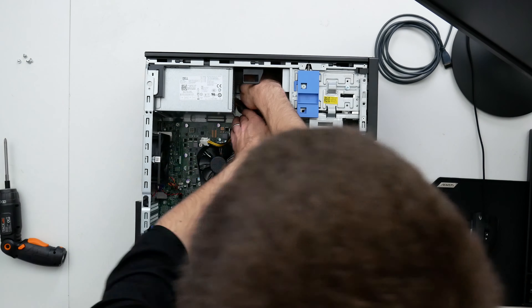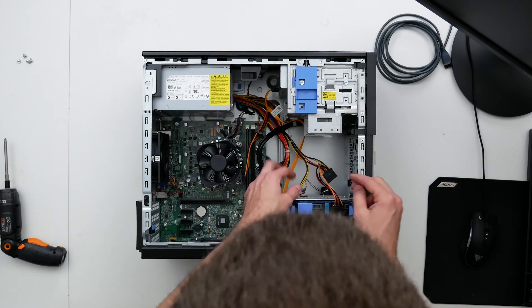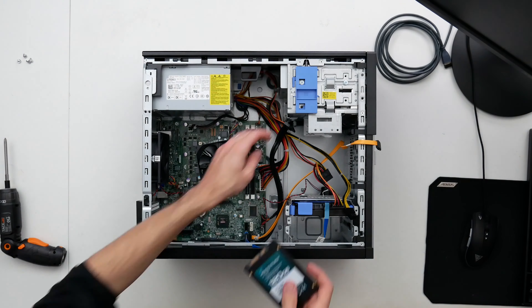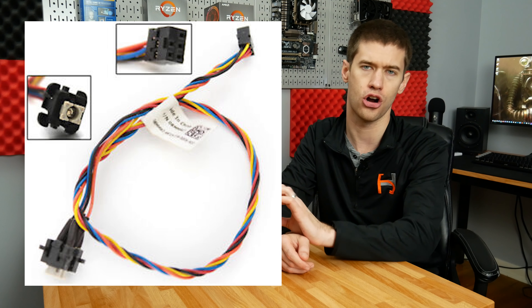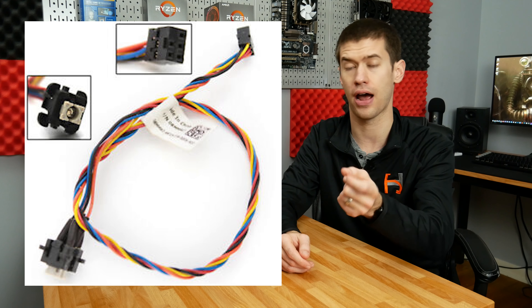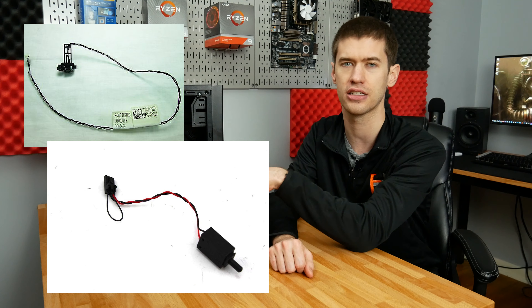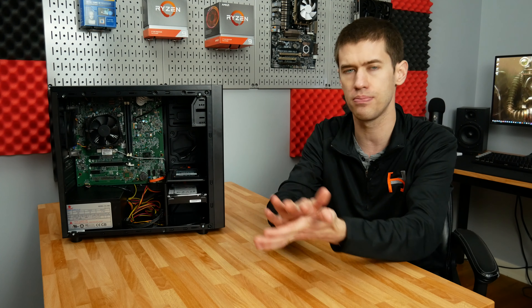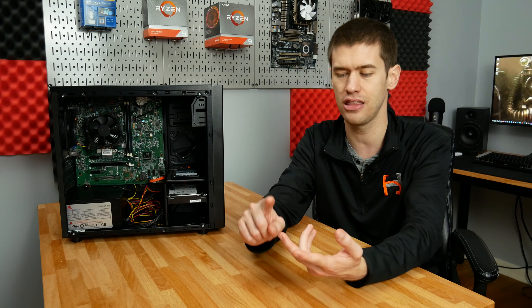With the Optiplexes I most commonly use on my channel — from the 2nd and 3rd gen Intel Core series, Sandy and Ivy Bridge processors — the biggest problem is the power button, which is a weird five-pin configuration. You can get it started with a standard two-pin power button, but then you have to hit F1 because there are error codes. There's a temperature sensor in the front and an intrusion sensor if the panel is off, but both can be relatively easily bypassed — you can tape down the button, tuck it into the new case, and move the temperature sensor into the new case.